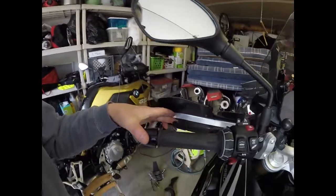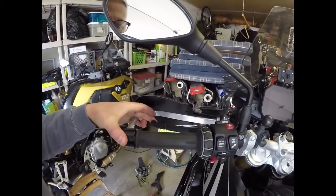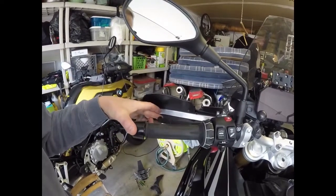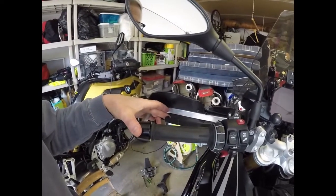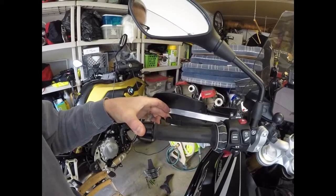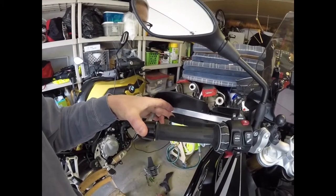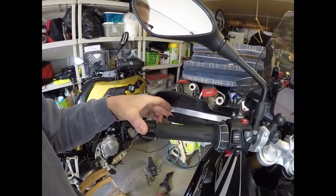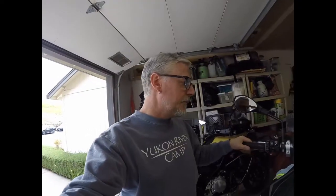And on this bike, the free play gain is the amount that this lever will pull back when you are in neutral and you rev it to 4,000 or 5,000 RPMs. This guy should pull back on its own, and I believe it sticks there after you get back to idle. So you're looking for an eighth to a quarter, so it's not a lot, an eighth to a quarter of pullback. So we'll start it up, and I'll grab the rubber band, install that, and then we'll see what it does.